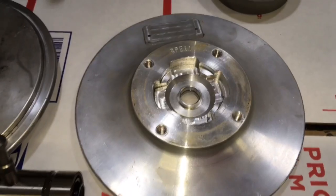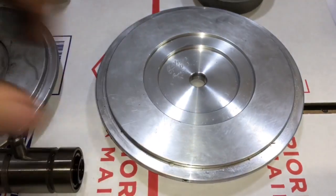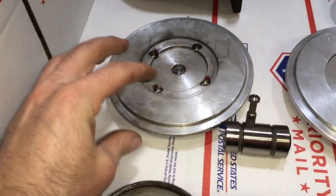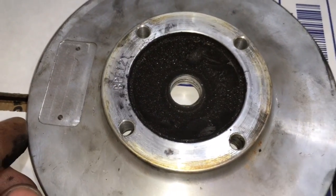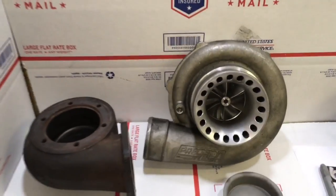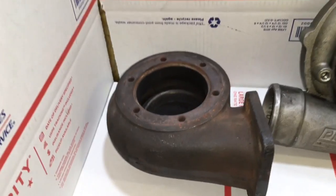The difference was that the Gen 2 had a slightly tighter ball bearing cage on the inner race to be able to fit in a journal bearing turbine wheel shaft. On the right, the Gen 1 was able to use the GT37R style version of the shaft where it was staggered, which matched the cage.